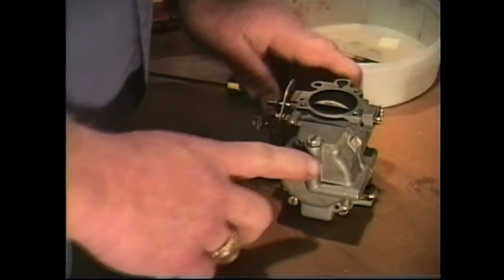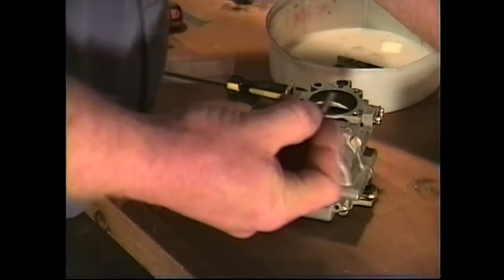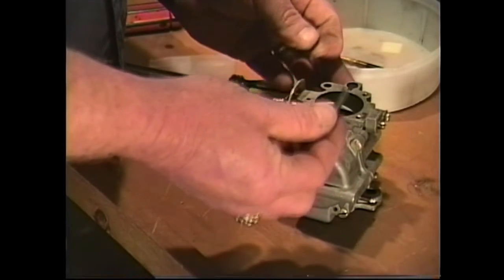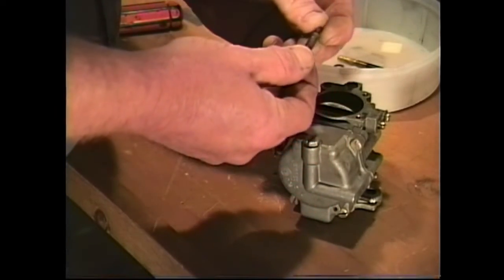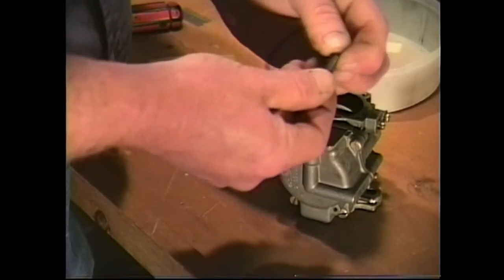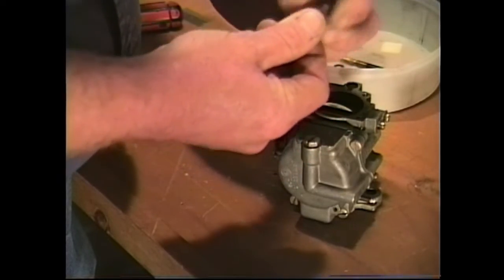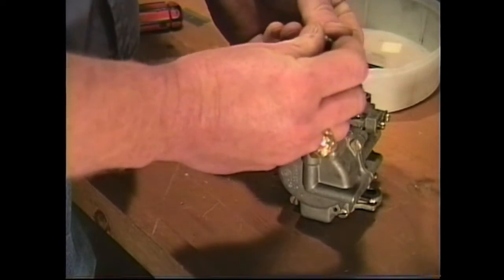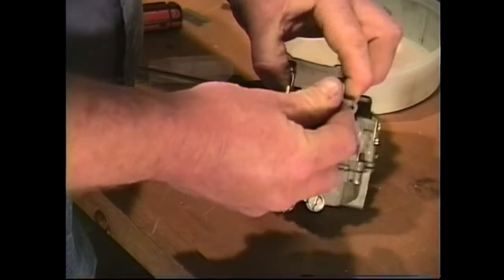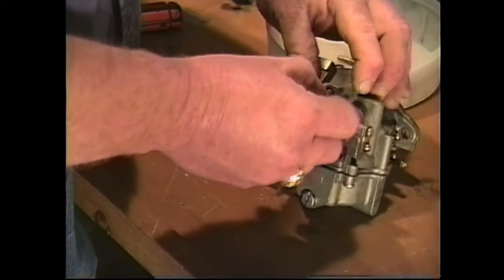The only other thing we have to do now on this particular carburetor is replace our low-speed orifice screw. Now this particular one we took off had a fiber washer. This particular one has an O-ring. So we're going to go ahead and just slide this rubber O-ring down on this screw all the way down, just like so, and go ahead and we'll start it into the carburetor,